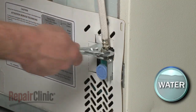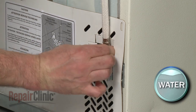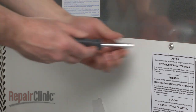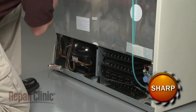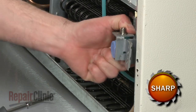Your first step is to disconnect the refrigerator's water supply line. Be prepared for some water to spill out. Next, remove the screws securing the lower access panel and pull the panel off. Remove the mounting screws to release the old water inlet valve from the cabinet.